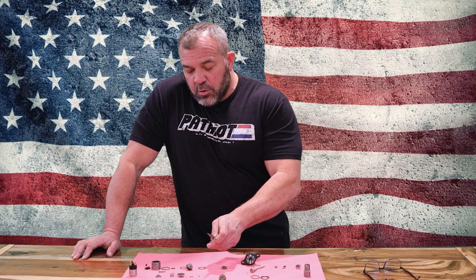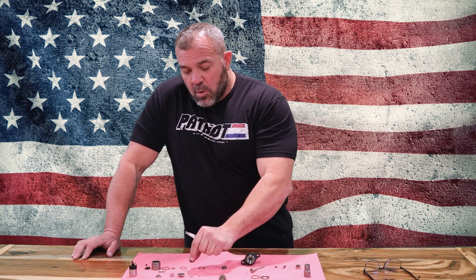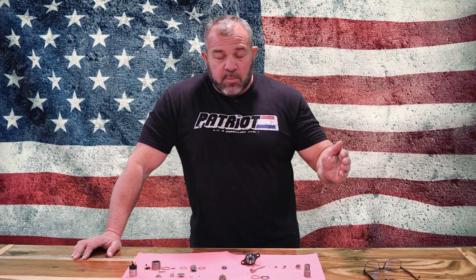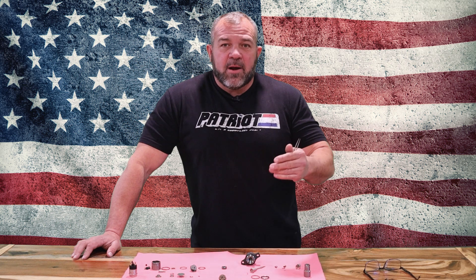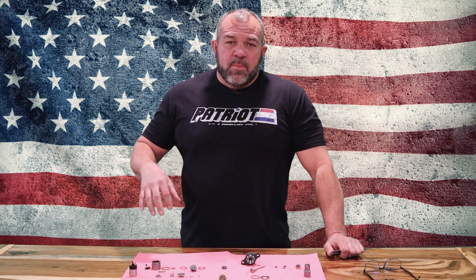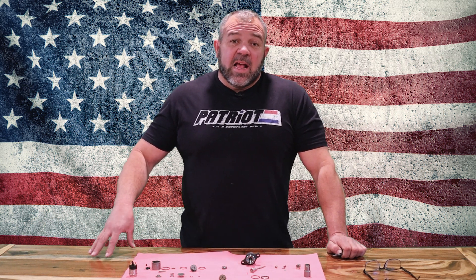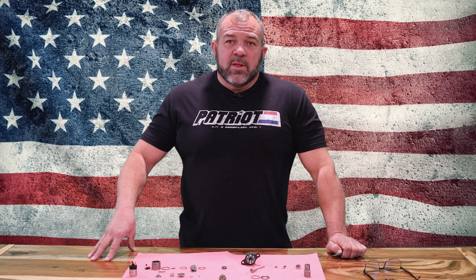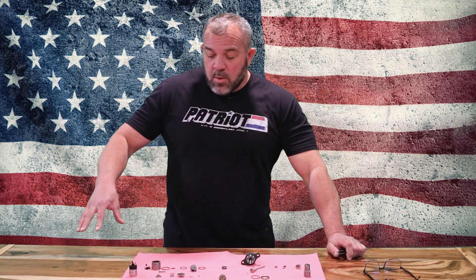Armatures don't need replacing — we disassemble, wash, clean, tumble, and they're good to go. That is the breakdown from left to right, top to bottom of the injector, and what we're going to replace. Now, with the control valves we've been testing and using, we've had these in this shop and in our trucks for over a year. Friends' trucks have been running these control valves — they calibrate very nicely and have not failed at all.